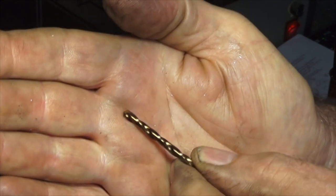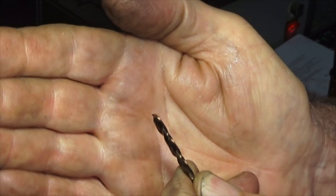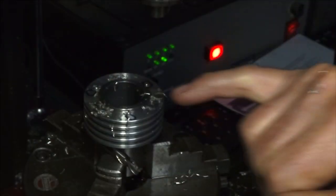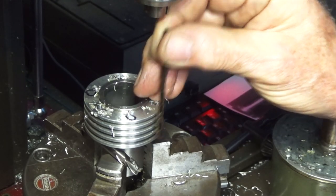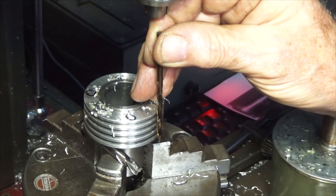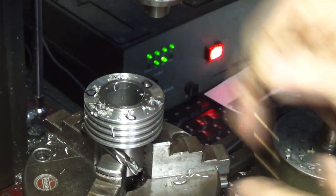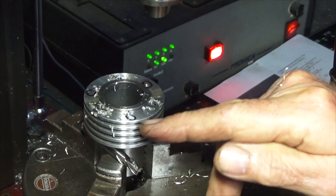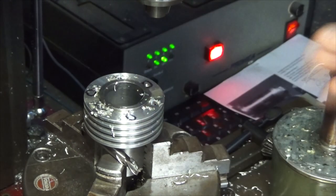Just going to have to talk over the rain here, but this next drill bit is a brand new cobalt bit with a split point. I bought this specially for doing the other three holes — these holes have to go right through all the fins and we've got to be really careful that the drill bit doesn't wander off on the way through. I'm hoping this will give us the best chance of getting the hole to line up. The biggest issue is that if it deflects inwards it's going to rub against the side of the bottom of the grooves, look untidy, and may not line up with the holes in the crankcase.